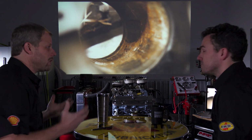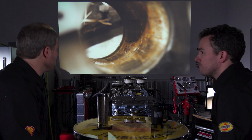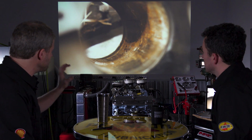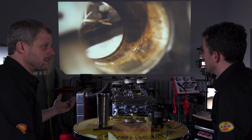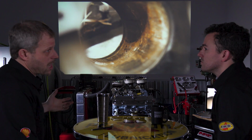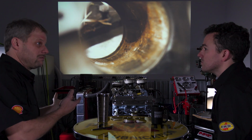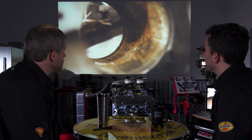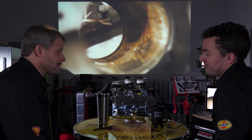Since I have no history at all on the engine parts, I really don't know what happened to it. Based on the fact that the piece there is pushed into the water jacket as opposed to into the cylinder, tells me the block didn't freeze. It was some damage. The piston came apart and the rod whacked it. I don't know that the rods I have are even the matching rods to that block. Right, because you'd expect to see a mangled rod or something. Yeah, exactly. Could have just been he got a deal on it. Block, whatever it was.